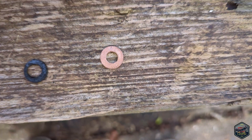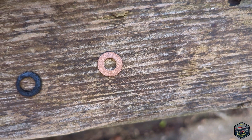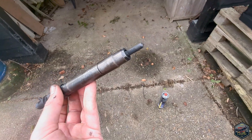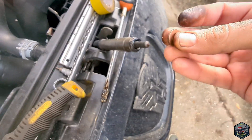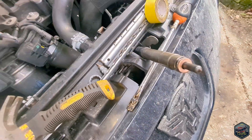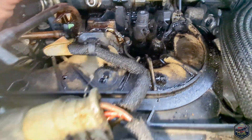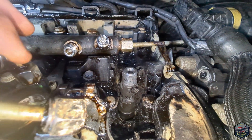I'm going to fit the new washer and hopefully repair the return piping to get it going again. I've cleaned the injector up the best I can, and I'm going to put the new washer on the end with a bit of grease so it doesn't fall in, then seat it back in. I also undid injection number three so I could slide it in better — just take note of that.